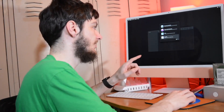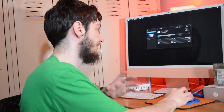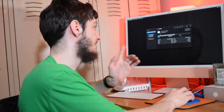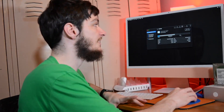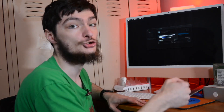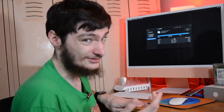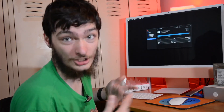Go to Disk Utility and click Continue. This is where your Time Machine backup becomes very important. Select your internal hard drive — in this case, Macintosh NVMe — and erase it, erase everything on it. If you don't have your Time Machine backup, you are screwed at this point — all your stuff is gone. If you're smart, you already made that backup. It's also just good computer practice to constantly back your stuff up.